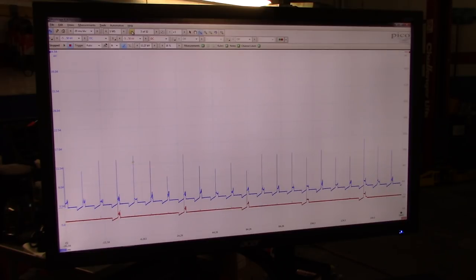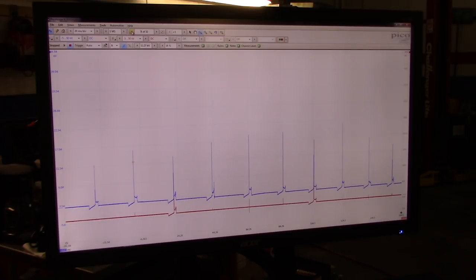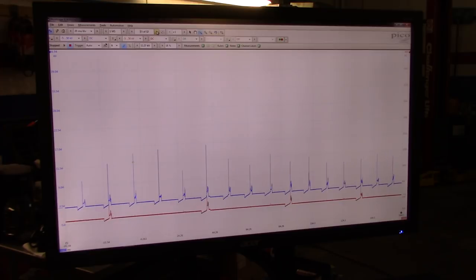Again, we're doing the snap accelerations, and nothing is even happening when it's under load. It's just at idle, and we already saw before that at idle all the waveform looks pretty decent. Going all the way to the end, this is back at idle, and nope, no difference.